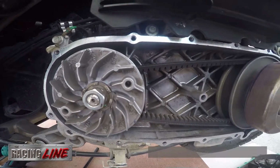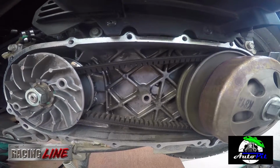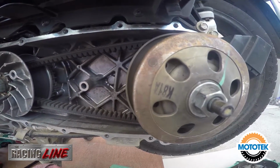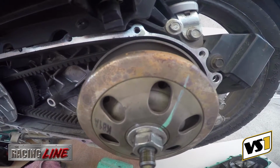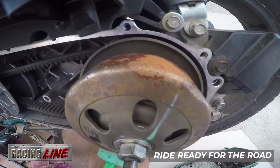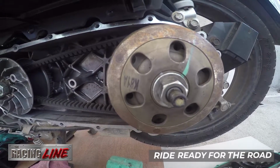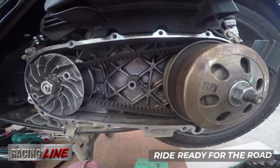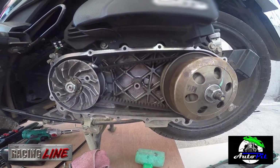When this is running, the dust builds up fast on the inside. First, the dirt comes from the worn-out residue of the drive belt and also the clutch shoe, which also accumulates dust buildup every time this bike runs. So imagine if you're using this bike every day, this dust buildup will just go round and round inside the CVT shell compartment, and over time, this will surely damage these parts here and there. And these are vital and expensive parts of your scooter.